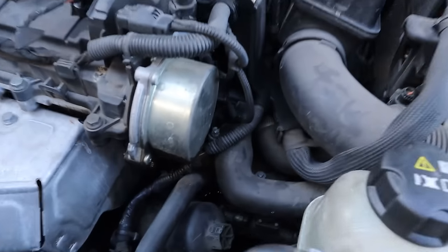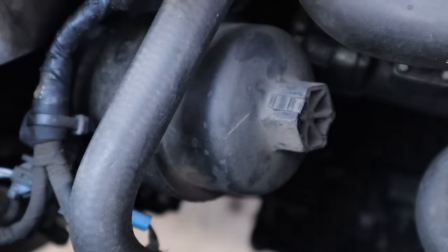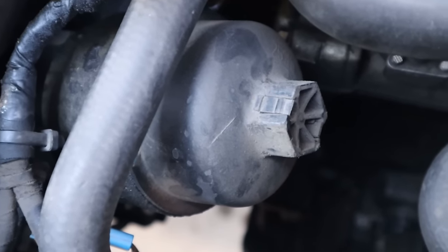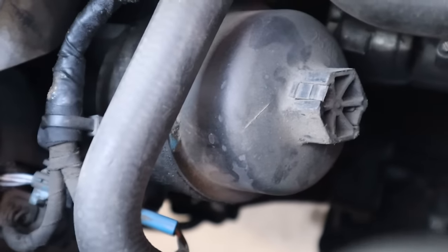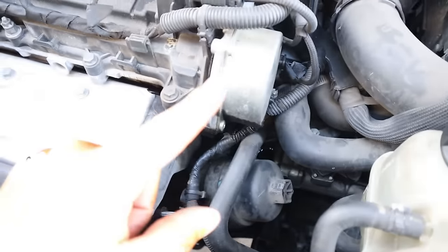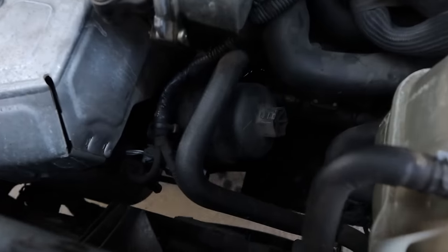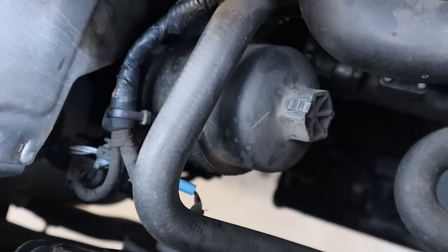And I don't think that this oil filter housing is going to be any different. That's going to make an absolute mess as well. So I've got to pull that off, and it's tilted. The only other vehicles I've ever done that had a housing like this were my E36 and the E46 for that matter. If I remember correctly, they point straight up. So yeah, this is going to dump all over the place as soon as I loosen that. I guarantee it.